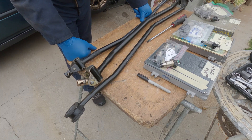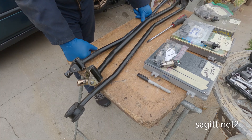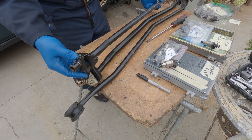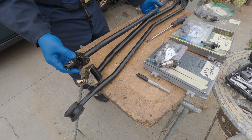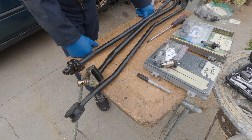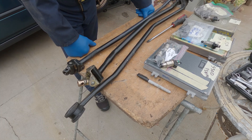Welcome back to the channel, SagitNet2. Today's episode is just a little update on the G23BK — I'm still on the pursuit of the ultimate driving experience. As you can see, I've got the G23BK shifter linkage removed because I'm still experiencing a misshift from fourth to fifth gear, and I really have to watch myself whenever I'm shifting into fifth gear, always slowly releasing the clutch. It's been a struggle.